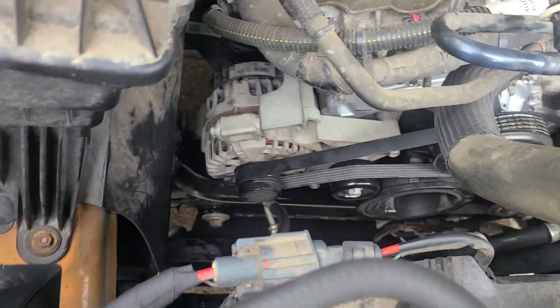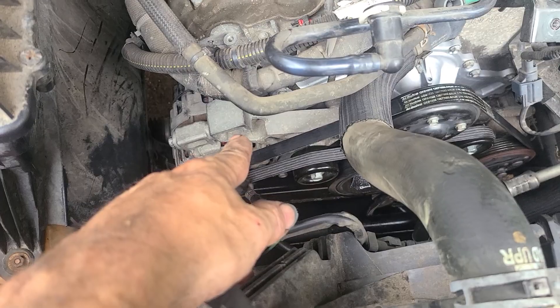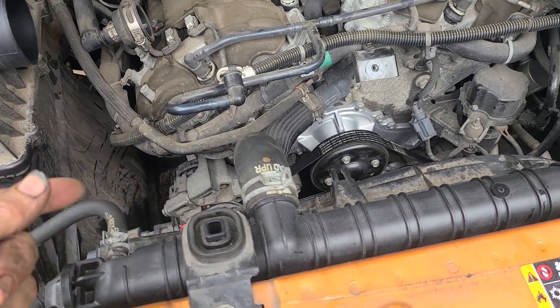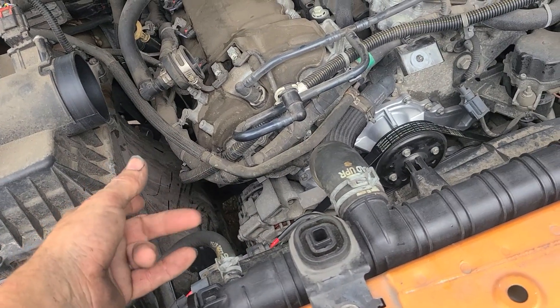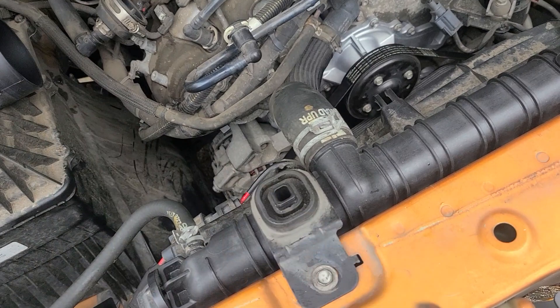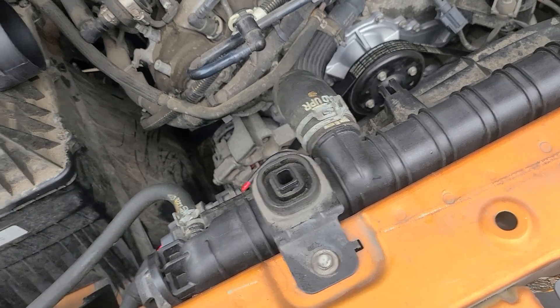Now begins the fun — you have three bolts holding your alternator on and you have to take the alternator off, because you've got to get the bracket that holds the alternator in place off. There are two bolts behind it for the bottom corner of the water pump. There's a top bolt which you can clearly see, and then two bottom ones. I did 100% of this all from above. The top one — take it out. The bottom one — unscrew it; I don't think there's enough clearance to actually get the bolt out, so just leave it in the alternator for a second.